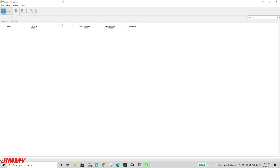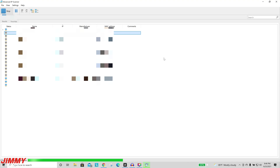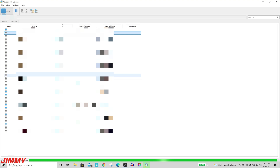Open Advanced IP Scanner, click on the IP field, and hit scan. It will search for everything connected to your network. You'll see a bunch of results — in a mining facility those are all the other miners. Look for a device with a blue lit indicator showing it's connected, and one with a little down arrow that you haven't seen before. That will be the KD Box. Double-click the HTTP link and that takes you right into the Gold Shell KD Box dashboard.